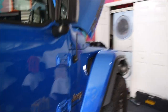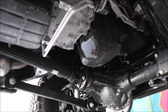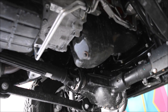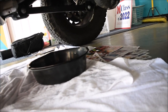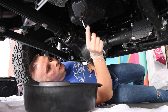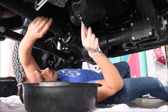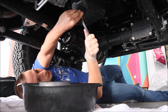Next step is to actually drain the oil. If you go underneath the Jeep, you want to look for the oil pan — it's pretty hard to miss. The oil pan is this little black pan right here and the drain plug is right there. That's going to be a 13 millimeter. You want to make sure you have towels or newspapers underneath just in case anything spills, and obviously you want to have some drain pans — I have two right here just in case one overflows. Sometimes the drain plug can be a little bit tight, so it does take some force to break it loose. I just have this little 13 millimeter wrench. It's a good idea to hold it down with your other hand and use some leverage to break it loose.